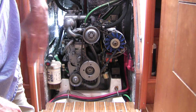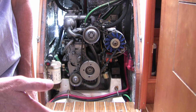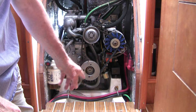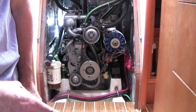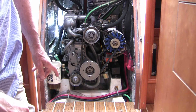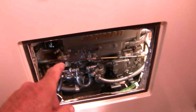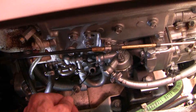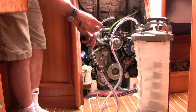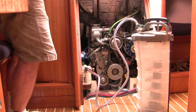One of the most important elements of boat stability is to have the heaviest elements like the engine as low as possible. That design is in conflict with the usual oil change method of sliding a tray underneath and draining oil from a pan bolt. So many small boat engines don't have a drain plug at the bottom, and if they do it's very hard to reach. Some have a petcock you can attach a plastic tube to and suck the oil out that way. But the usual method for Yanmar engines is to use a suction tube slid through the oil dipstick hole. The dipstick hole is back there — in a boat there's never enough access. We're going to take the engine oil dipstick out and siphon that old oil out through the hole.